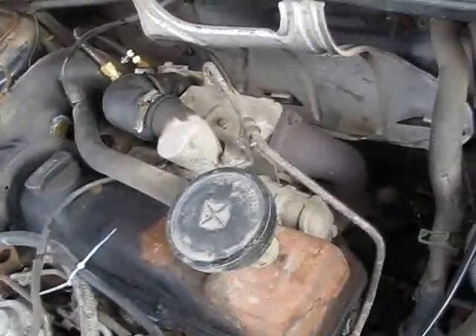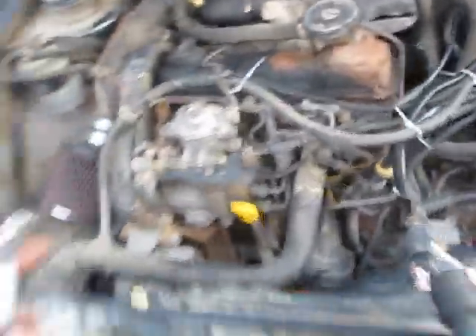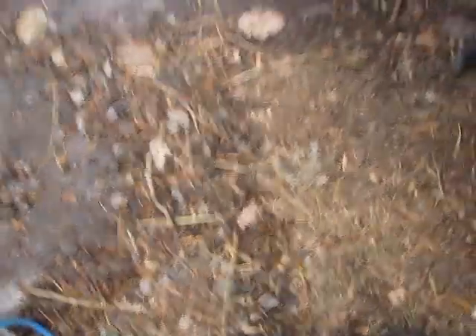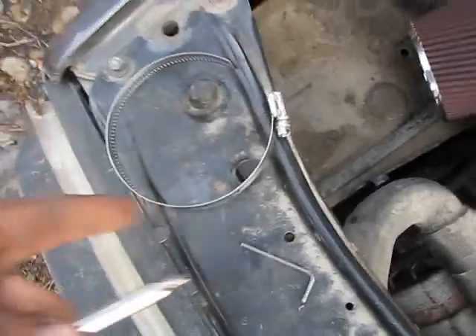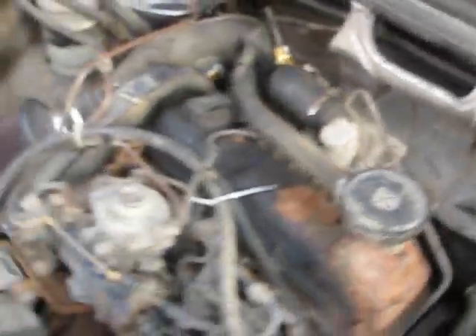Let's get the hood open. For the pyrometer, I'm thinking I'll tap it into the down pipe. My batteries just died but I got some new ones. Anyways, the pyrometer probe — there's three different ways to install it. You could do the hose clamp method, which is what I'm gonna do because I'm replacing the exhaust anyway. When I get around to putting it in the 4Runner, I want to mount it coming off the manifold, probably on the bottom.